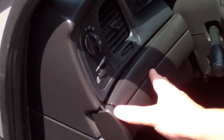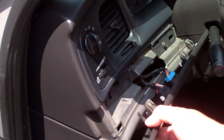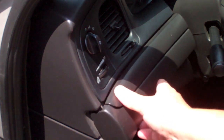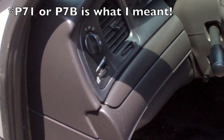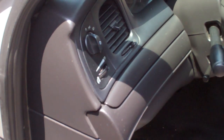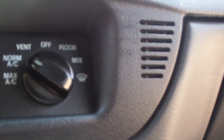If you've ever pulled this trim piece off, you'll notice there are two wire harnesses connected to nothing. Those are actually wires for adjustable pedals and traction control in the higher trim models. Whether or not they would actually work in the Crown Vic I've never tried, but theoretically if you bought all the other hardware and switches, those wires should be hooked up on the opposite end — though I'm not going to guarantee that.